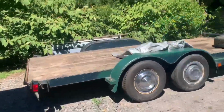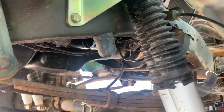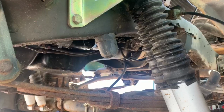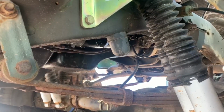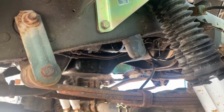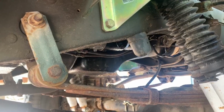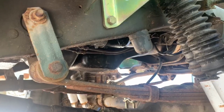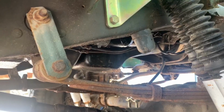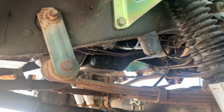Got a little bit more time to throw some wrenches on the old girl. We had some problems with the starter, as you probably were aware of in our last video. Since then, I pulled down the starter, fixed some connection issues and ground issues, and pulled the starter apart. I think what caused the major problem was that it was not shimmed correctly, so it kept colliding with the flex plate ring gear. It was burning up one of the contactor plates or contactor washers in the starter solenoid. Pulled that apart, cleaned that up, found one of the copper studs there.